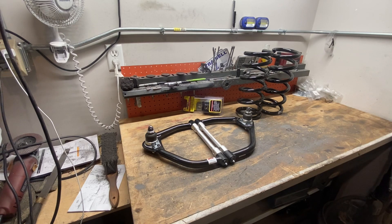Warning to anybody building an S10 Blazer: be fully aware that all of the rear leaf springs they sell on eBay — basically every aftermarket leaf spring I've found — are not set up for the weight of a Blazer. I never heard anyone say you have to run a heavier spring with a Blazer because of the weight back there.